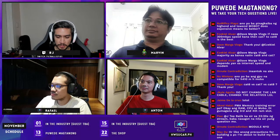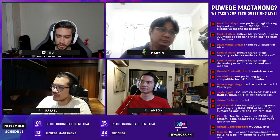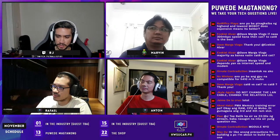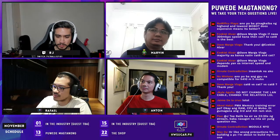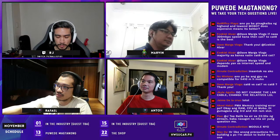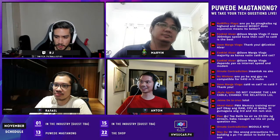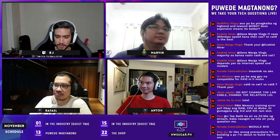In terms of speed, whichever is the lowest will be the benchmark for them running together. So if you have a 2133 and a 2666 set of sticks, when you run them together, they're both going to be at 2133. It just defaults to the slower speed. Right. Yeah, and there is no issue.